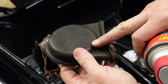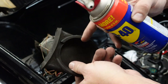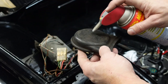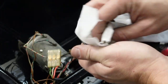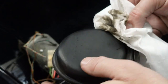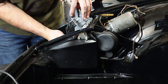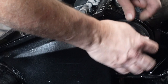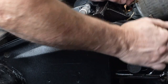Before we go any further I really need to clean this rubber piece — that's the piece that sticks through the metal and the rod's going to be through there. I like to use WD-40 to clean rubber; it has a really great way of loosening up all the crud and making things look like new. There's an R imprinted on this, and guess what that's for. We'll take the push rod and now install it for real through the rubber, then going over to the motor and taking a C-clip to anchor it. Now we just have to take this rubber piece and stretch the lip over the edge of the metal tray.